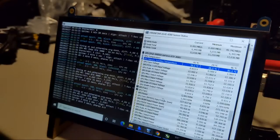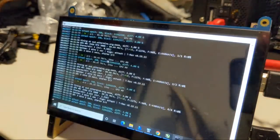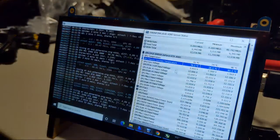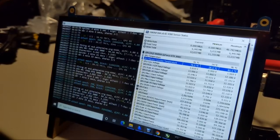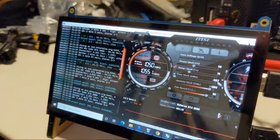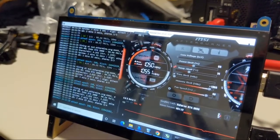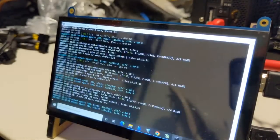Okay, I'm back, guys. What are we seeing right now? What are we getting? 99.25 mega hash, 227 watts, 78 degrees Celsius junction temperature, so that's good. It's under 95. Okay, I don't think the minus 502 core worked, so I'm going to go to minus 400 again. I want to see if that brings it back up just a little bit.